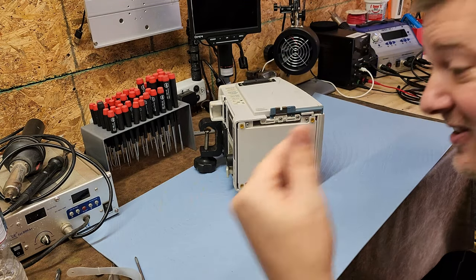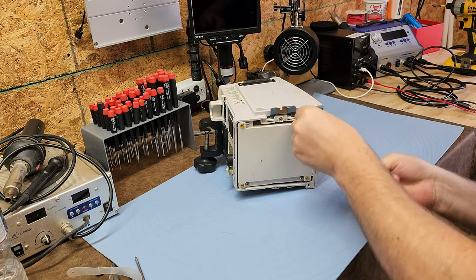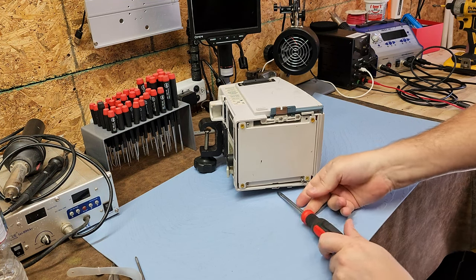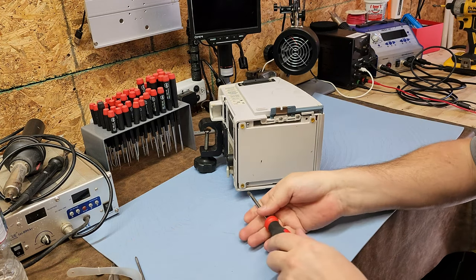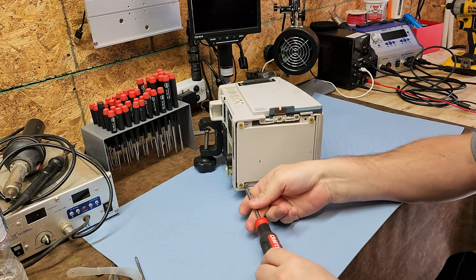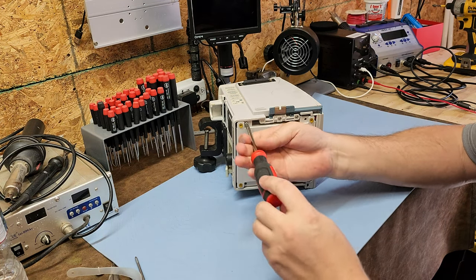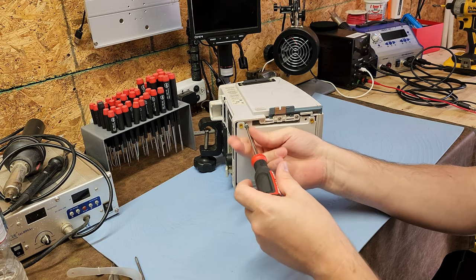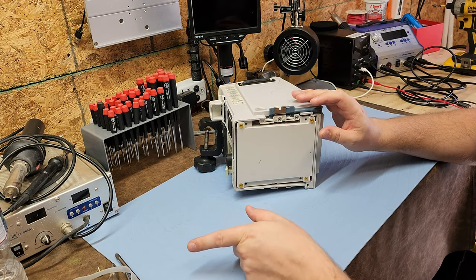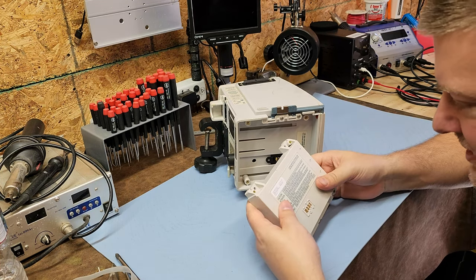Let's go right down to the base plate because that's where the battery is. Unlike some devices, this one has four screws to get into the battery. Sometimes this device will go into a critical alarm and it will continue alarming — there's nothing you can do to shut it off except remove the battery. Your customers will call up very upset with it screaming at them, and that's because the battery on the bottom has to be removed. Note that there were a couple of different types of fasteners on the bottom.